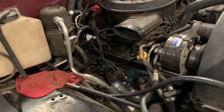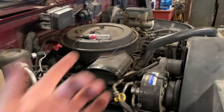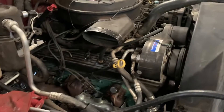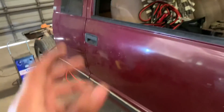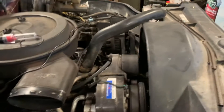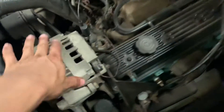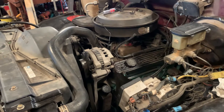That's how you do a relocation. For any car or truck, buy zero-gauge wire directly to the starter, then four-gauge like a booster cable hooked to the fuse box and alternator, and make sure you have solid grounds. With one battery I'm hoping it handles lights, AC, and radio fine. If push comes to shove I'll get a heavier-duty alternator — factory is around 90 amps, but Rock Auto has one at 200 amps.